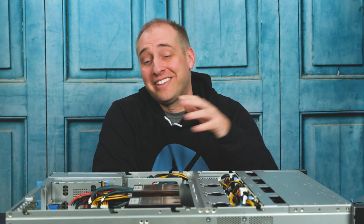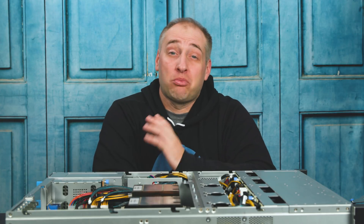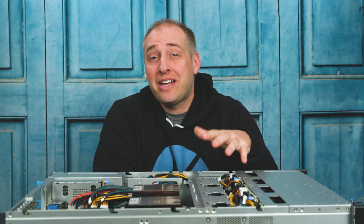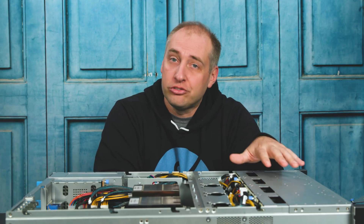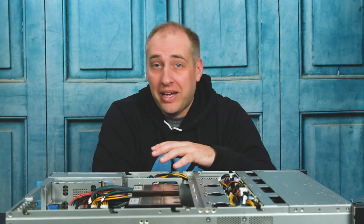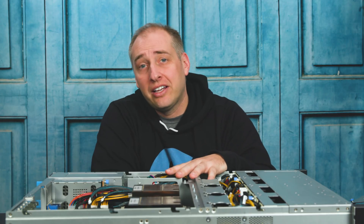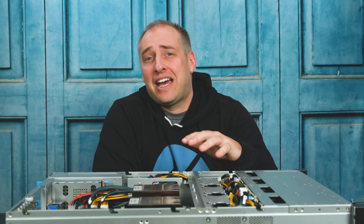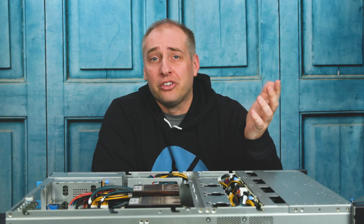In terms of power consumption, this thing can vary a wild amount — you have 1200-watt redundant power supplies, which are absolutely great and usually plenty for a system like this. We had configurations running at over 800 watts with high-end CPUs, hard drives, and a whole bunch of expansion cards. On the other hand, when we used some lower-power processors without as much high-performance storage networking gear, we actually had the system running at about 350 watts pretty normally, which is pretty good for a system like this.